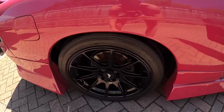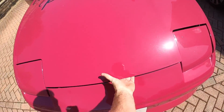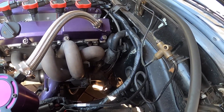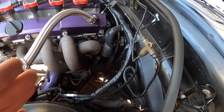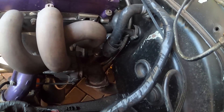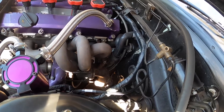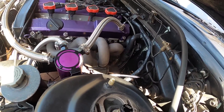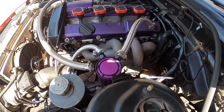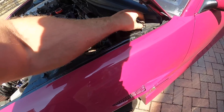We're back home. Everything went well — our rear brakes seem fine. We have got one little problem: I felt something smelling. So I've come under the bonnet — you can see how that's touching the manifold, that bit of rubber there. The new silicone hose for the heater matrix is longer than the other one, so I need to cut it and push it forward, or just cable tie it around the other one. It keeps smoking and smelling, so before we go out tonight we need to pull that hose over and cable tie it. The whole engine bay does get hot.